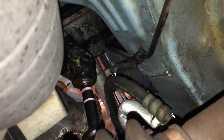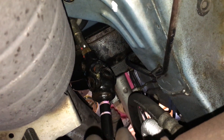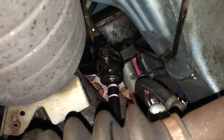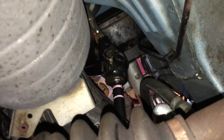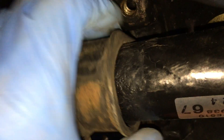I've marked the U-joints — universal joints — using nail varnish in pink on the top part so I know exactly where to get it back on and the steering alignment is exactly the same as it should be. Once you've undone that 12mm at the top, you remove these two bolts here and these two bolts on this side, and then this side comes down — happy days.